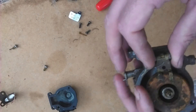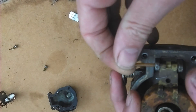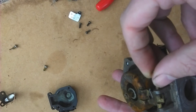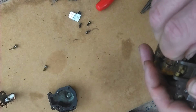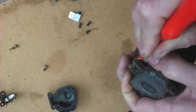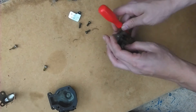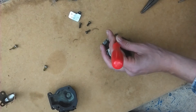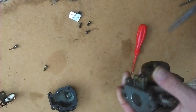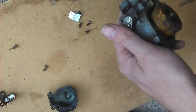Here's the float. There's a little spring clip that holds the fuel needle valve in position, and then there's a little nylon rod that secures the float assembly to the carburetor body. It's quite a snug fit so you might need a screwdriver or pliers to push it home. The pin on this got slightly damaged so it was necessary to trim it a little.